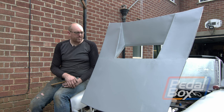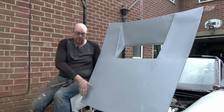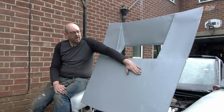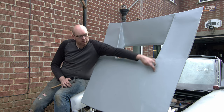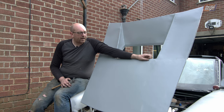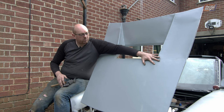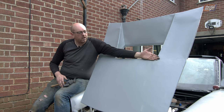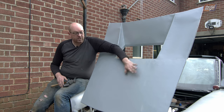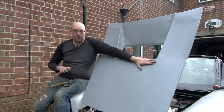For the last couple of days I've spent about six hours reforming the shape of the bonnet, and it is a lot better than it was, I assure you. Previously one corner actually dipped down and the other side was up, so now it's one continuous curve all the way across the front. That's taken a little bit of work because the ribs that run down the centre is where most of the deflection needed to be done — obviously the most inaccessible point. Where I've been using the tool from the inside to pry it up it has left a few small dents on the top that push out rather than inwards, so they still need taking down. But that's almost impossible to see until I put paint on it, and having put the paint on I can now see where I need to give more attention to.